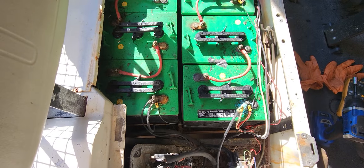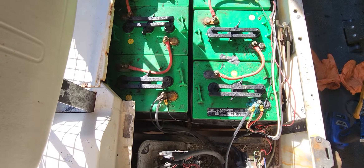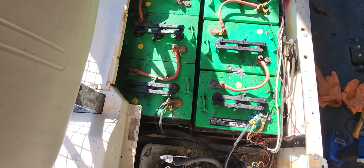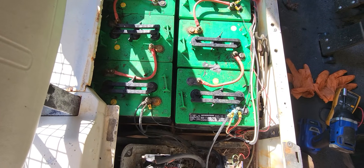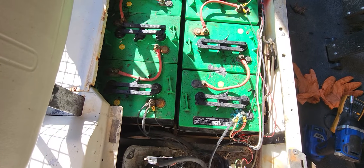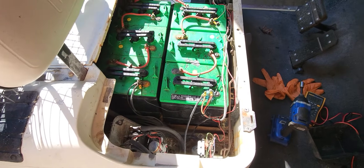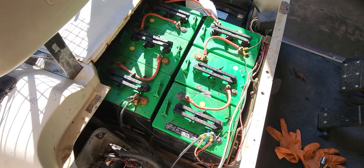The biggest thing you need to understand when diagnosing electrical problems is: there are things that can go wrong, and then there are things that most likely are going to go wrong. You want to start with the things most likely to go wrong — typically that will be moving things, anything that's exposed to corrosion. Those are the things likely to go wrong first. Solid-state things you want to check last; things that are mechanically controlled you want to check first.